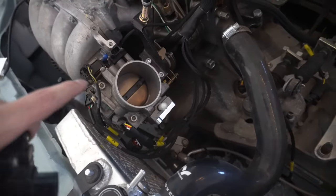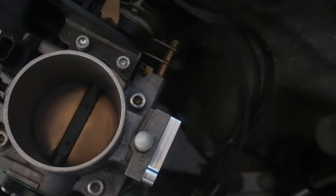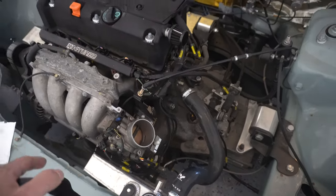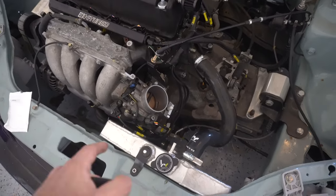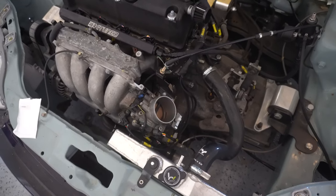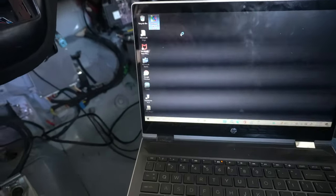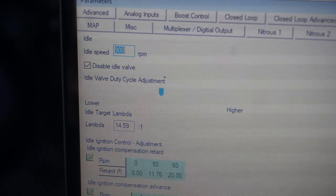You just have to set the idle screw — there's an idle screw somewhere, oh it's right there. You can adjust that screw a little bit, so we'll see if we need to mess with that. Alright, so right now we're gonna put back the intake, bring out the computer, disable the idle air control valve in KPro, and we'll see if we have to mess with the screw to adjust the idle. Waiting for HondaData to load up — alright, so right there we have disabled the idle valve.